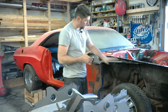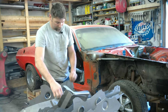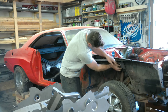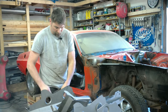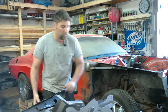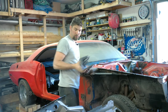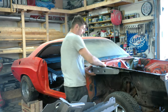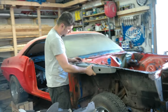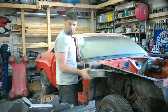This area is going to be for the front cowl and the front apron area. They're going to weld up in this area and strengthen it. You've got some side pieces right here that are going to support them. Then you have the cowl braces — we're going to have to do some modification, but they're going to fit somewhat like that. That's going to stiffen this area and then that bracket will bring it right down to the front suspension, basically tying this whole car together.